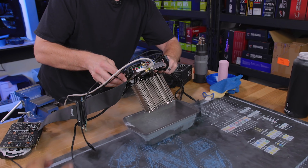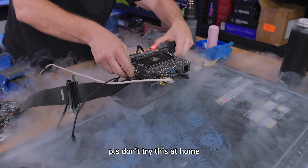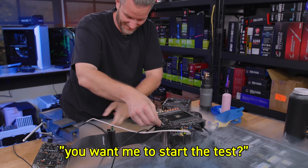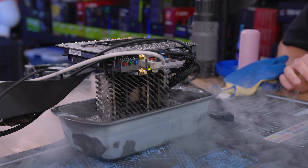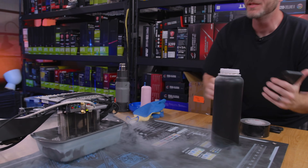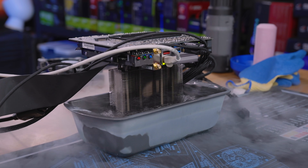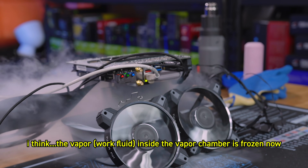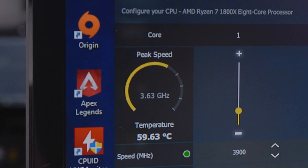This is phase two. You want to start the test? Yeah. Start it. Well, the tubes are freezing. It's at 21C under load — so far it's 10 degrees colder, but it's still climbing. I don't think this is working like we want it to. It's not working! Look how frozen the cooler is though. I think the vapor inside the vapor chamber is frozen now and it's not transferring heat. Look at that. Okay, let's stop it — that didn't work at all.